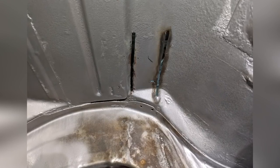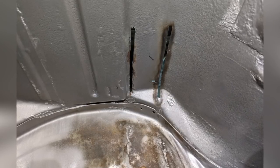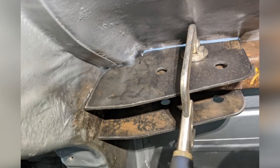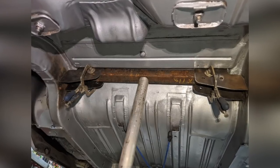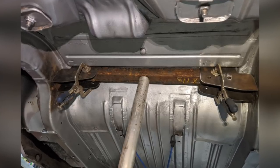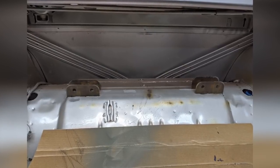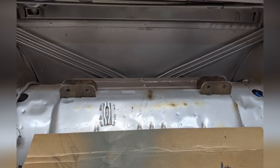Here's where they're going to push through the floor. The frame of the car is where I'll weld these brackets, but they have to extend through the floor of the car. Half that bracket is actually pushed up into the trunk. I've got them clamped into place along with a crossbar so I make sure they're lined up exactly, and I'll have a support on the bottom as well as the top. Here's the brackets pushed through the floor of the trunk — these will eventually be welded into place in the floor as well as the frame.